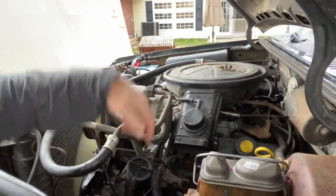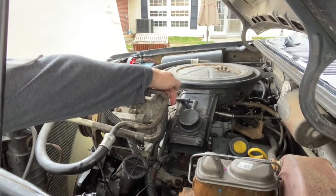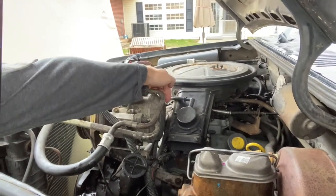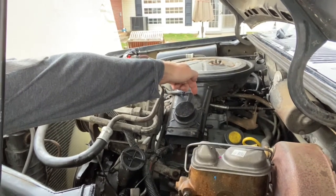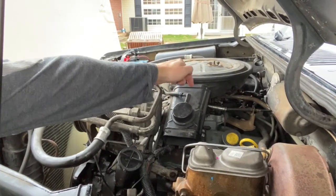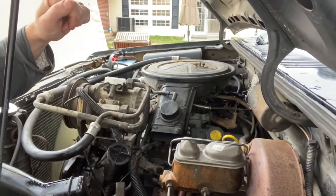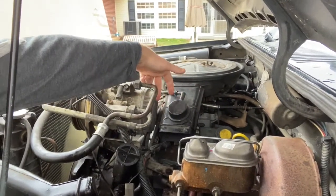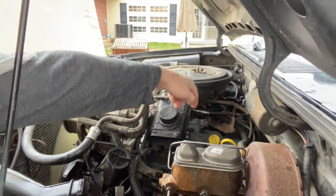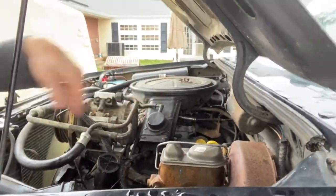You can see it's missing, you can hear possibly the tapping coming from one of these two cylinders. I'm really hoping it's valve lash, but it might be hiding something deeper in the motor. We're going to get this up to operating temperature, take that valve cover off, and check the lash on those first two cylinders. I've already listened - it's not at the back, it's one of the first two.